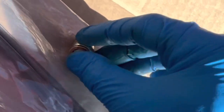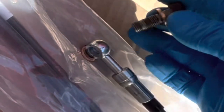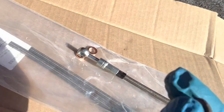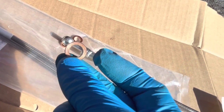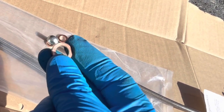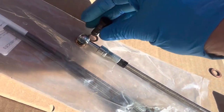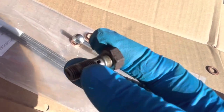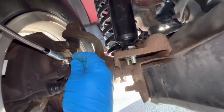Here's your hose — when this goes on the vehicle you're going to have one washer on the inside and one washer on the outside. That way any fluid coming down this hose goes into the hole in the bolt and comes out this little opening here. This bolt allows fluid to flow through it. These rings will tighten and seal. You can see on the old ring how grooves were cut into it as it's tightened down — that keeps the brake fluid from coming out, so it's like a gasket made of soft brass. When you torque this down it creates a gasket; the fluid flows in through that hole and out through that hole into the caliper.